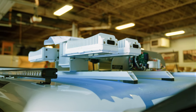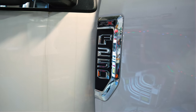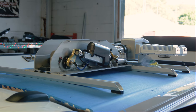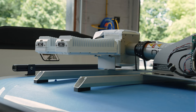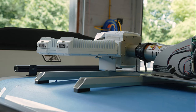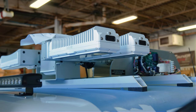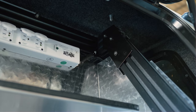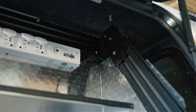As you can see we've got a Ford Super Duty truck. It's mounted to the cap. We've taken great care into making sure that it's got a structured platform mounting it. You can see up top aluminum unistrut that's bolted down to the cap. The light tower then sits on top of that and picks up the holes, which allows us to distribute the weight out and tie into our mounting points on our platform inside of the cap.